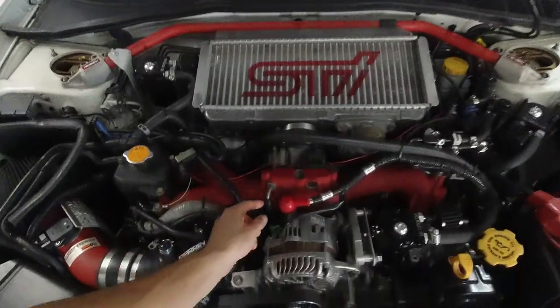So what was going on: while the switch was on, while the solenoid was on, if I were to finally give it boost after the break-in, while tuning actually, the cutout would close on its own. So I'm thinking, what's going on? Why is it closing? It's because this valve remained open and the pressure built up in the intake where it was connected, still in the same spot. Instead of vacuum, it was getting plus 10, 15, 20 PSI, whatever the turbo was boosting.